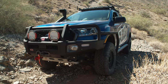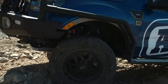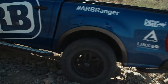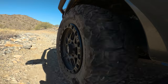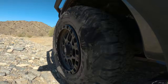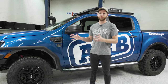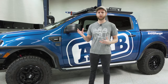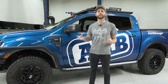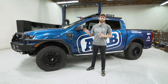With that suspension they also have BFG KO2s, which are an all-terrain in 285/70/17 — the same size we ran on our Ranger — and it fits really nicely here. Obviously there still had to be some trimming for crash bars especially with the bumpers added, but with this amount of suspension lift you don't get a lot of rubbing or catching on the inner fenders. It's very quiet, functional, and the truck can articulate without the tires tearing things up.